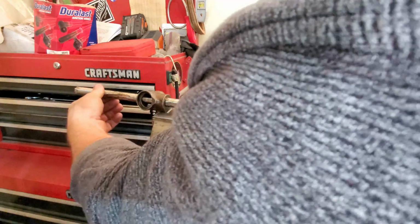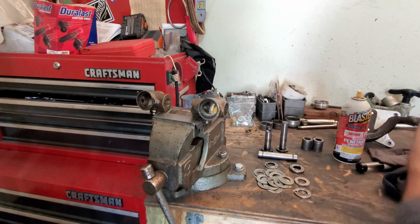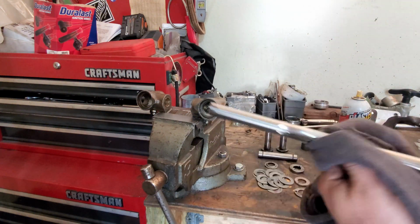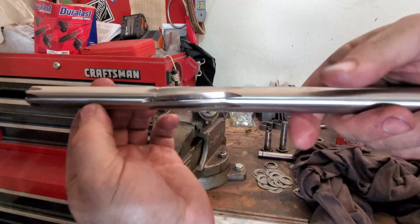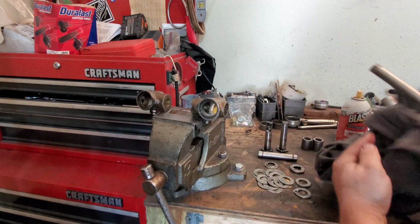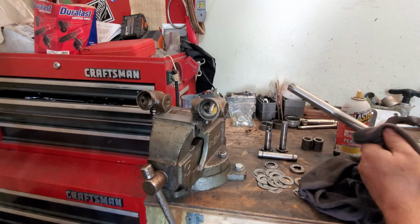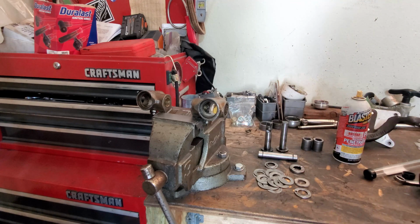And then you'll clean off your reamer once you pull it through. Be careful though, these things are sharp. And you can see there's not much that was on there. You can see the sparklies though. Caught a little bit. Whenever you run new bushings through though, believe me, it's gonna eat off a little bit more, quite a bit more.